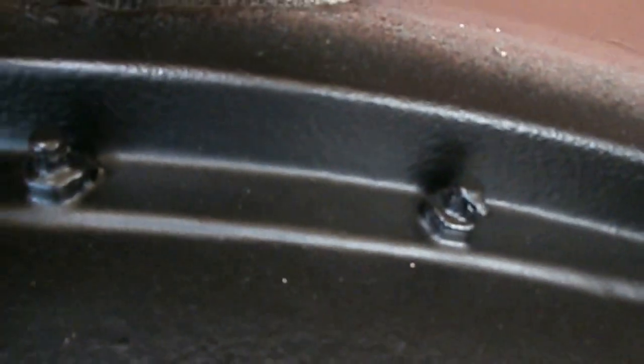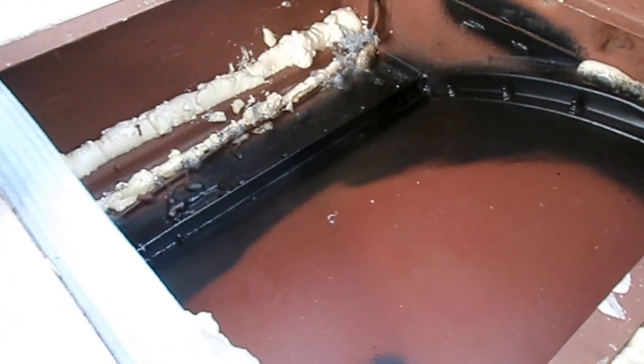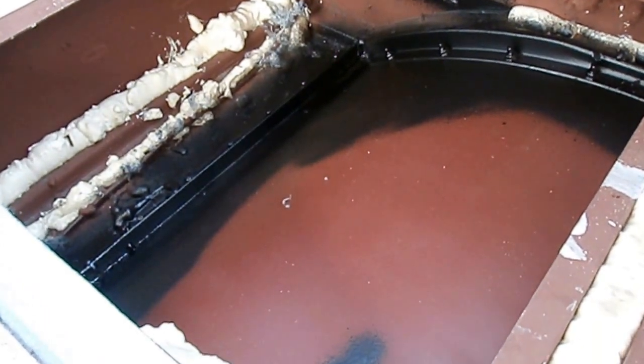So it's nice to have those done. I've taken basically this rubber flex and I've sprayed that along the edges and over the bolts. So what I've done is essentially sealed that gap right there. I'll go over that little section again, but you can see how it's all sealed. I sprayed the bolts as well. So it's doing its dual purpose in my eyes. Not only is it sealing from water entering, it's also going to prevent the nuts backing off.